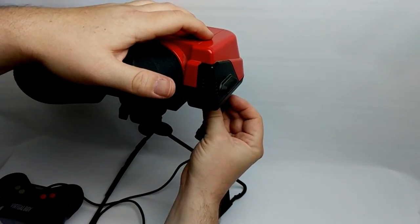It's time to check it out and see if this did its thing. I know it's kind of hard to see here, but that's the left lens that was giving me distortion before. You do get the refresh flicker, but man — it looks so much better than before. I am proud to say that the covering iron trick works. Using a covering iron provides the direct heat and pressure needed to that solder joint to fix this on a more permanent basis, and it keeps you from putting electronics in your oven.